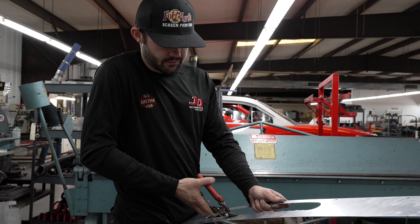You can see how it's kind of buckling up right there. It's because a lot of these side skirts, the holes aren't all in the exact same place. So what I'll have to do is get the trusty rusty unibit and drill them out one size bigger, because they've got these big washers on them so you don't need to have the exact right size hole. I'll drill those out to about a quarter to five-sixteenths, and that way I can have more maneuverability with the side skirt.